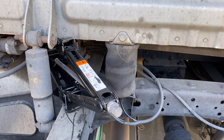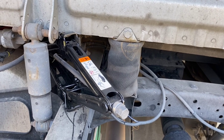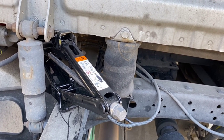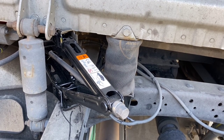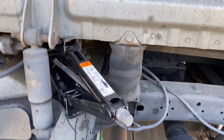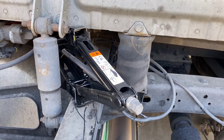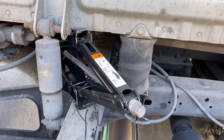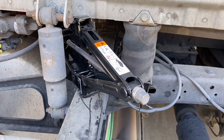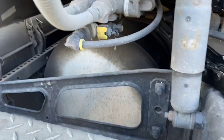One thing I wanted to explain: what I decided to do was go ahead and air the truck back up. When I aired the truck back up, the sleeper cab raised up about a half inch. I went ahead and adjusted the jack that half inch up that the cab moved. Then I gave it a couple of cranks to raise it even a little bit further until I heard the air escaping out of the leveler.